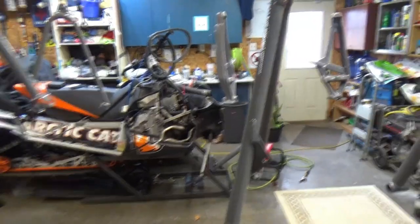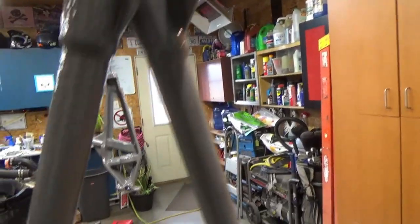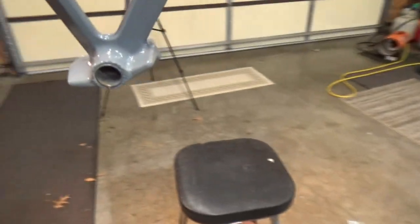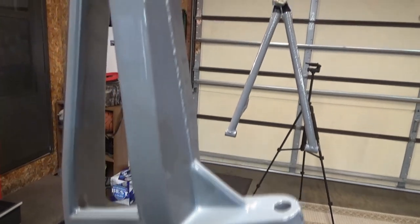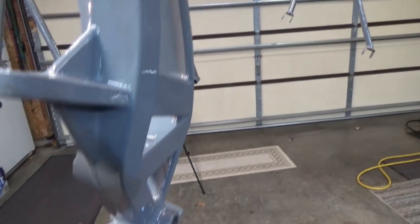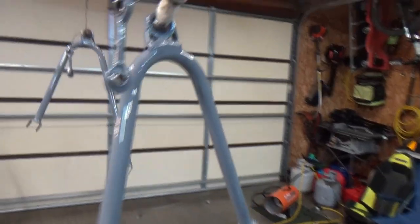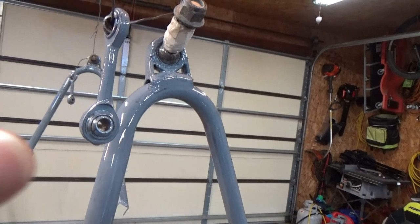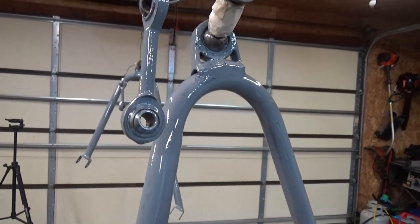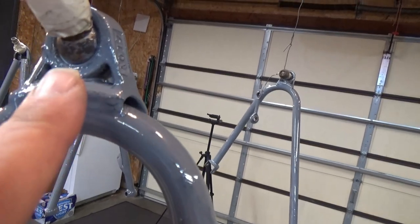This is the end of the second coat of the rust preventative. As you can see, it's flowing really nicely on the metal now and starting to self-level. The aluminum parts are pretty much like glass — smooth as silk. It's amazing when you can get a reflection out of just gray primer paint. The only issue I'm seeing is on my ball joints — they're starting to stick because the paint is hardening, so I'm going to have to free those up after this second coat.